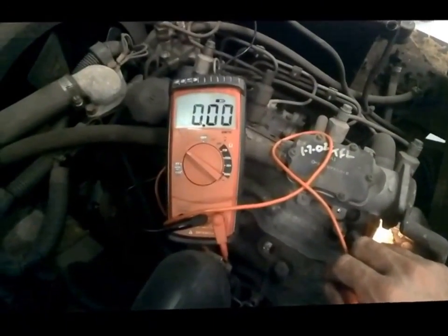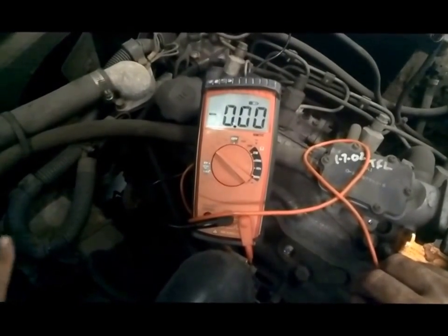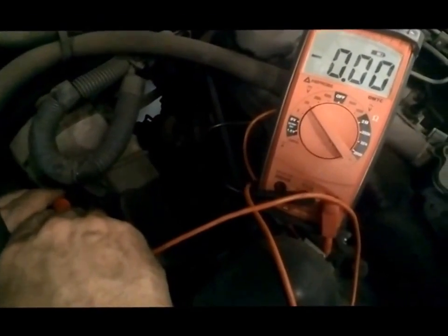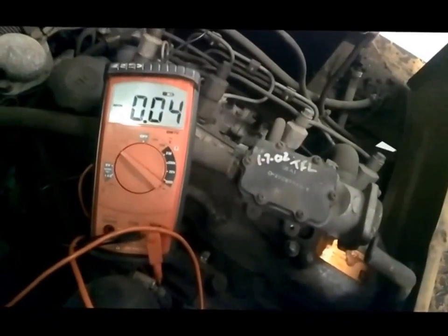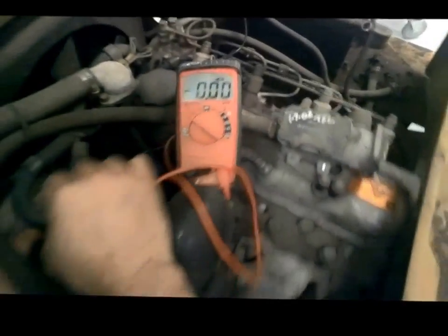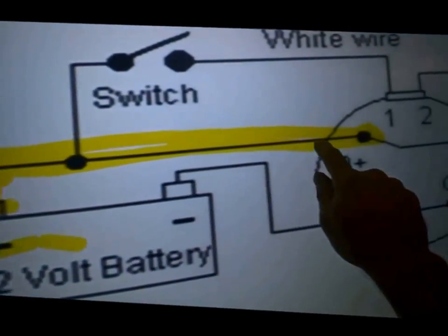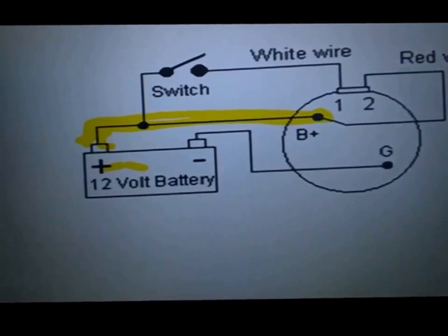To save on time, I went ahead and checked the ground circuit — the ground circuit's good. But I did find that the BAT circuit, the output circuit of the alternator, has nothing. Battery voltage on this is 12.7 volts. Right at the back of the alternator on the output, we've only got about 40 millivolts. So I should have 12.7 volts. We found our circuit — we basically have an open circuit; maybe something got disconnected. We'll look at a more detailed wiring diagram, see if we have any blown fuses, get that circuit fixed, and then check charging system voltage again.